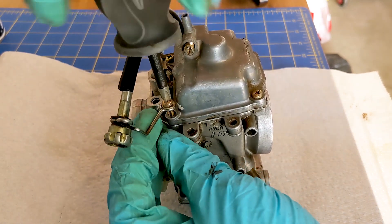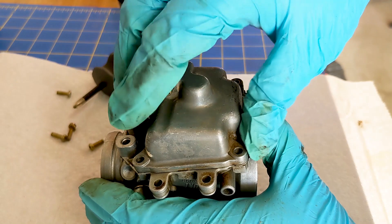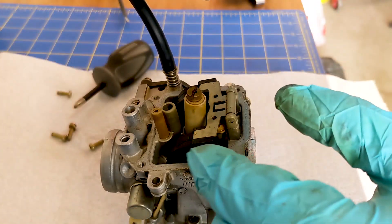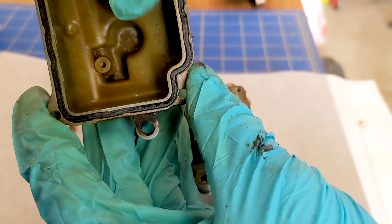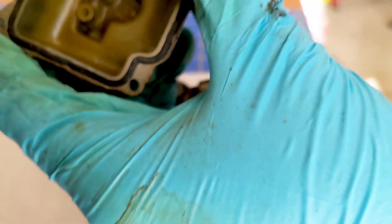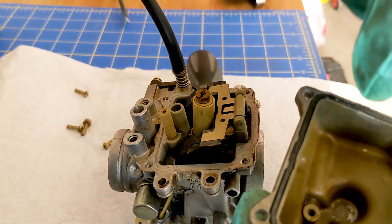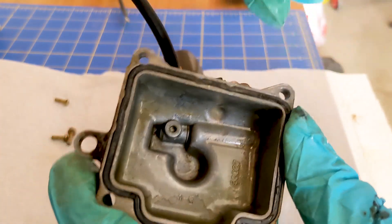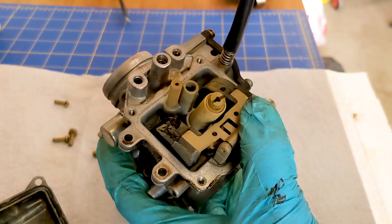One of the first things you have to do is take the bowl off. Underneath the bowl you have a couple different parts. On this side you have your gasket that seals the bowl to the main part of the carburetor. In here is your drain screw — comes through that edge, attaches right there. I'm going to clean that out; it looks like there's some stuff in the bottom. Yeah, there's some gunk in there. I'm going to use some Simple Green, water, and a toothbrush for that. I just cleaned that out — you can tell it's pretty filthy. I'm going to use some carb cleaner on this. Inside you have an idle jet and a main jet.